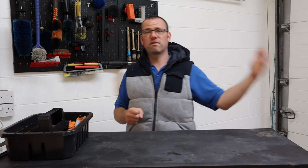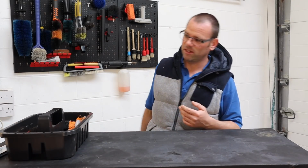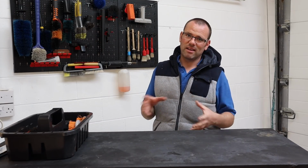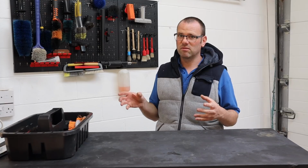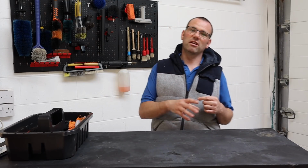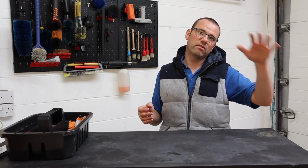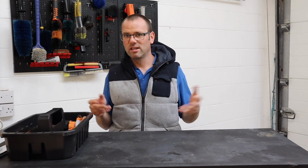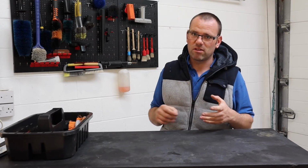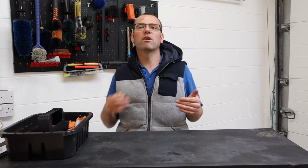Some people like to work from the inside out, but I prefer to start on the outside and work in. The reason I do that is because the door edges and things like that tend to be filthy on cars, especially ones that haven't been cleaned in a long time. If you're climbing over that door sill, you're dragging the muck in with you on your legs or your trousers, and then you're getting into the customer's car, which I don't think is good. So it's best to give the car a wash, give the door sills a jet out at the same time, and then you're climbing over, not dragging any muck in with you.